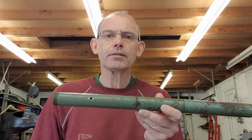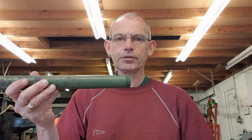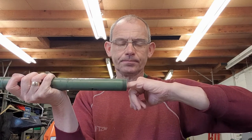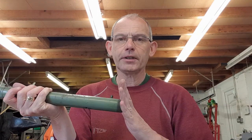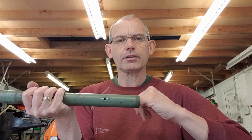How do we get silver solder out? That's a very high temperature process. I've been looking into this and of all the methods suggested - intense heating, furnaces we haven't got - the best one seems to be brute force. Get your fork leg held in a vice with soft jaws, then take a hacksaw blade - just the blade - and cut a slot straight through the old bush, hopefully not too deep into the fork leg. Then turn it around and do another slot about a centimeter apart, then possibly another one.